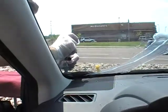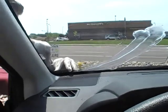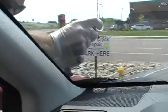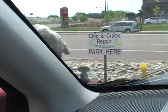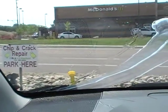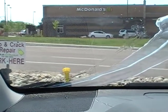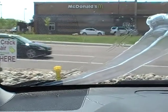And that's about as far as you're going to be able to see from here. It does get gappier as you get towards the edge, so if you've got to keep adding resin, that's fine. Just pull the piston out of the injector, fill it back up with some resin, and keep on going. Be careful not to disturb the vehicle — getting in and out, opening and closing doors. If you have to, do it as gently as possible, but if you can avoid rocking the vehicle, try not to.